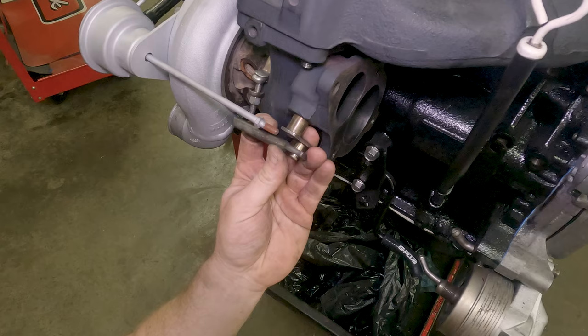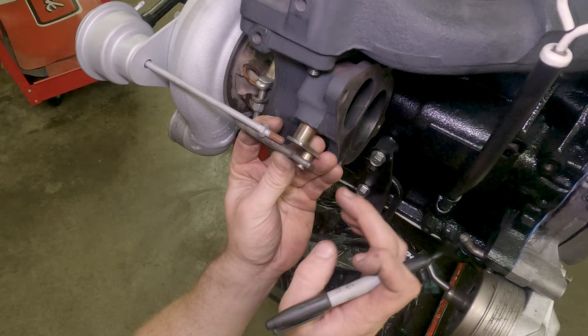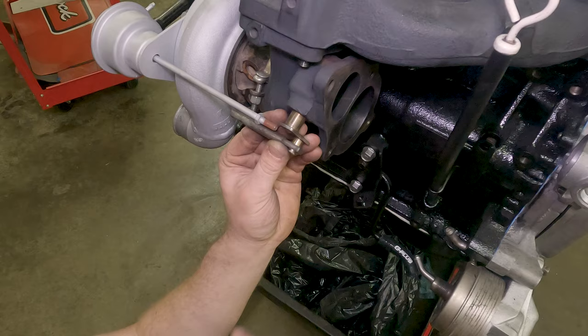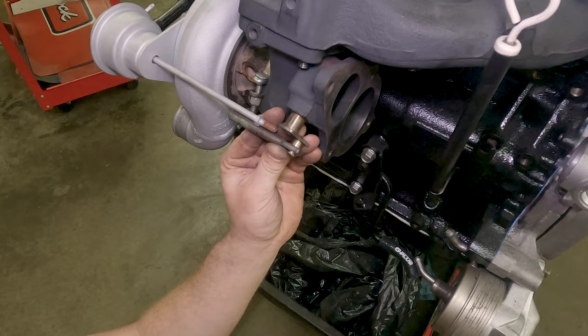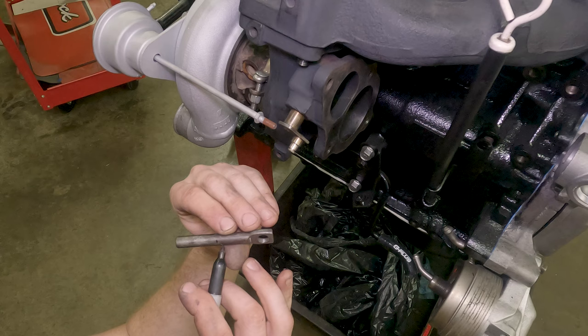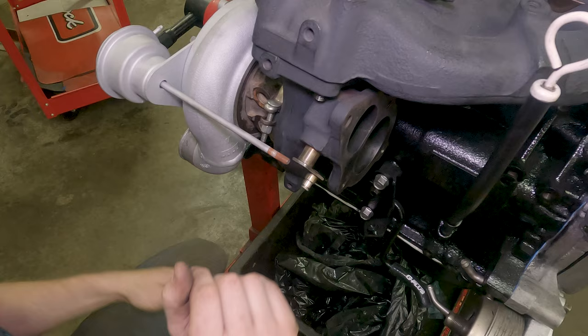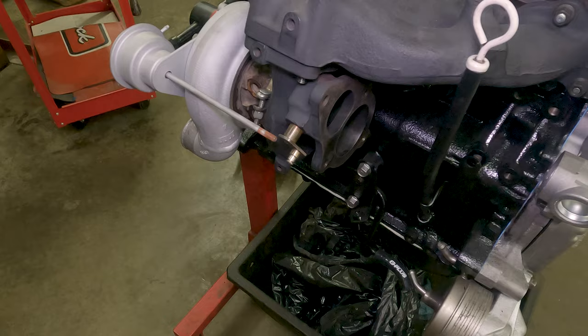Oh, sure. So we probably want to bottom it out shut. Actually, oh no, we want it shorter. We want to be able to add more tightness. Yeah, we want to be able to preload the spring. Actually want it shorter than this. It has to be shorter than that. So maybe to where the rest line is. And we can take the jam nut off. I'm still thinking we cut it from right here where that line is. Just on the hole. On the hole, sure. And that gives us plenty of meat to then tap it. Let's chop it down.